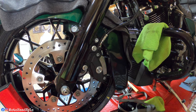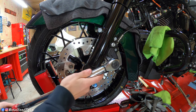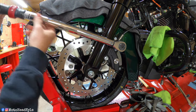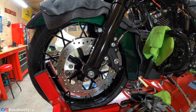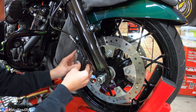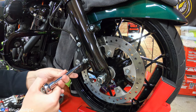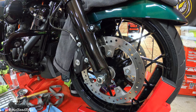The caliper bolts are 28 to 38 foot-pounds, but I'll snug them up with a ratchet first and then apply the torque wrench. Since it's 28 to 38 I'm going with 34 foot-pounds. Take it off, place it back on — good. Top one — off, put it on — good. Now repeat the same process for the other side, which is a little easier because there's no ABS bracket. Get the holes lined up and torque to 34 foot-pounds again.